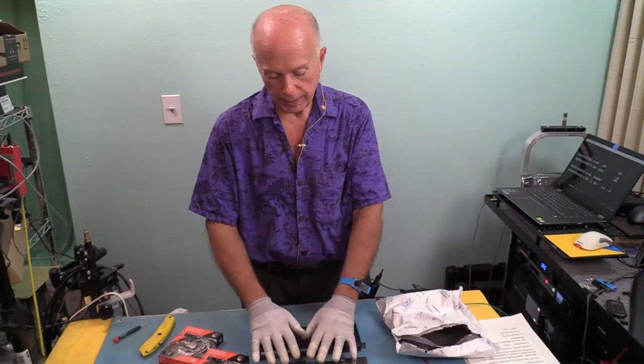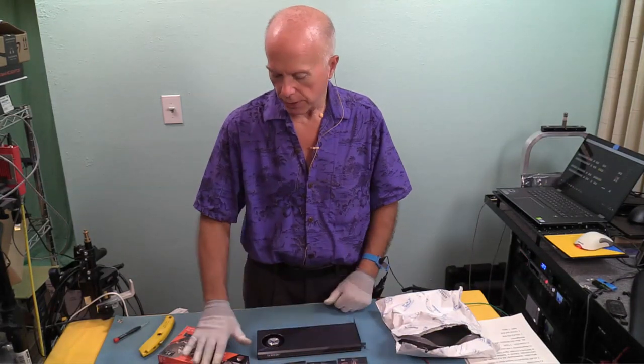That means I only need to get 2 more Seagate, or we pull off another machine. They need to all be the same, but the advantage of doing them different is if I put 2 in 1 RAID and 2 in another RAID, it's easier to identify the drives by name for the presentation. So clarity, so you know what I'm talking about. So we're going to take these 4 drives and put them on this card. These 2 we'll save for later.